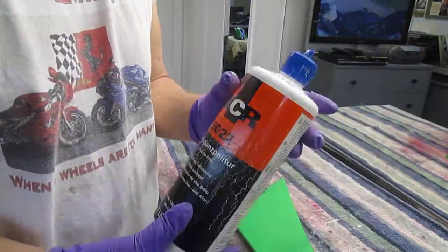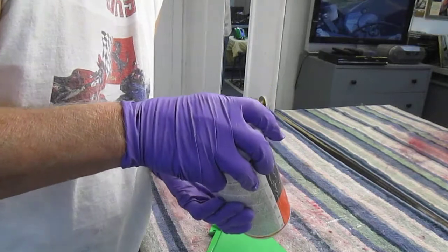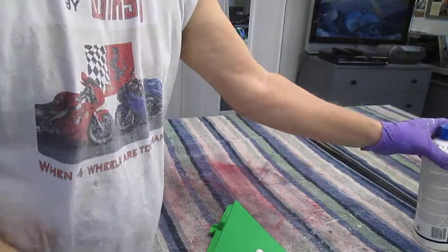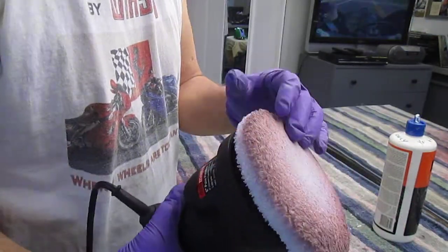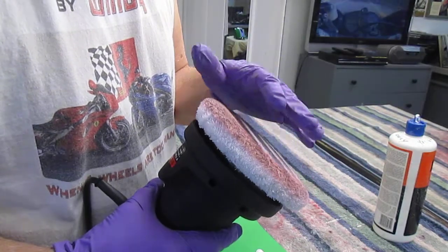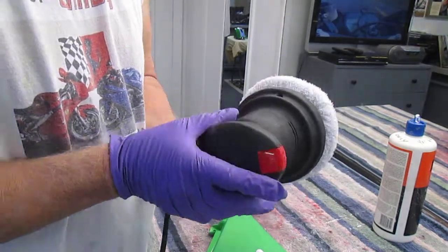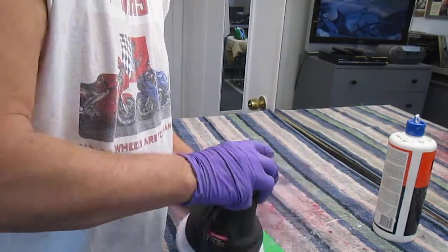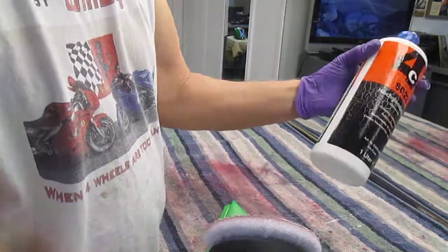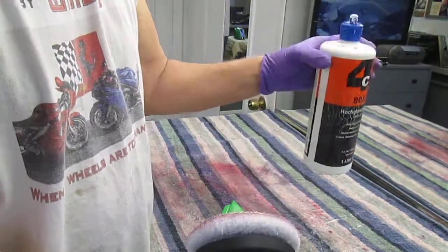Now, this material will take a little bit longer than normal to put a shine on to bring that gloss up. And again, because I already have some material on here. And when you buy these pads, by the way, at Harbor Freight, of course, very inexpensive, it's not a good idea to try to get the ultimate mileage out of them, because once they get hard and gritty, they're not going to put a nice shine on anything. I try to smear this material around. Now this material, which I get at the body shop supply, is relatively expensive. The buffing wheel and buffer is relatively cheap.